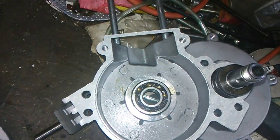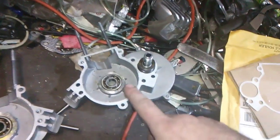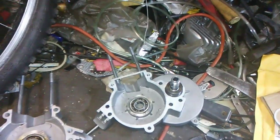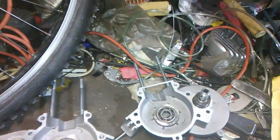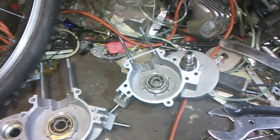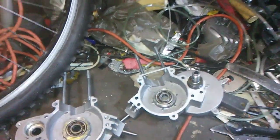There's your gasket. That's for the new Avenger bottom end and the old Phantom 85 bottom end. It's not called a YD 100 gasket — it's called an Avenger 85 gasket. It's a pretty odd gasket. Here's how you find out if it's the right gasket: when you order an Avenger motor, it comes with this. The bolt spacing is the same as the Phantom and the Avenger motor.